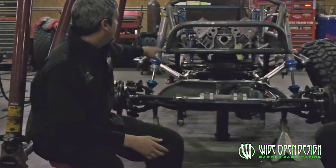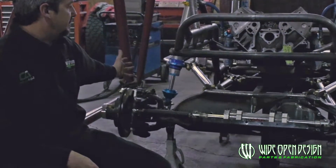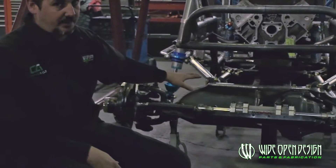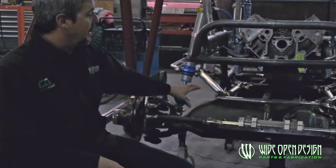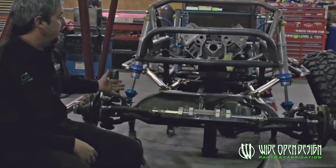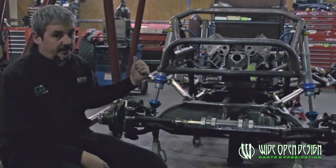You need to start out by fixing the buggy on a stand. Right here we've got a Jeep chassis — a customer sent us his axle, we built a custom truss for it, and mounted two-and-a-half-inch King shocks on it. We have it sitting on a belly jig so we know the height — that's whatever belly clearance we want at ride height — and jack stands set at axle height where the tire is going to ride.